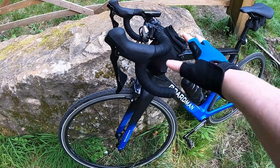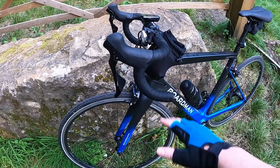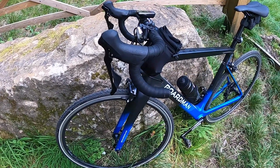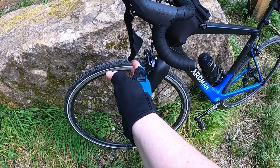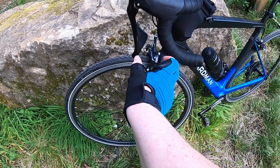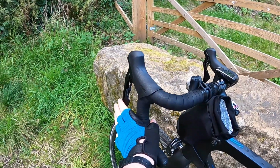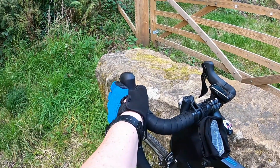Even if you have a bike fitter or somebody far more experienced who tells you to set your bike up in a particular way, and you find that's not comfortable, that's not the right setup for you, of course. But yeah, as I said, just making these levers have a shorter reach and shortening that gap. And I do see people riding bikes on the drops with levers that are just completely out of reach, and they're obviously more set up for the top hand position.